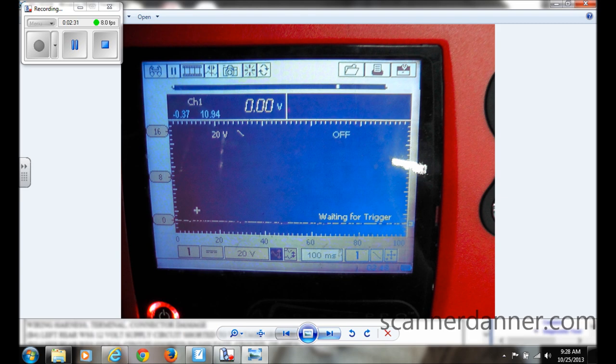We needed more help. If this is anything like the last one, the sensor generates a low voltage signal — somewhere around 0.8 to 1.8 volts, as we saw on the 2006 Chevy Colorado case study. We also had a previous case on an 04 Chrysler that was exactly the same — that same low voltage signal.